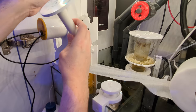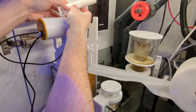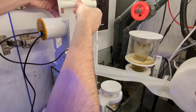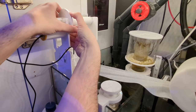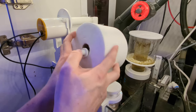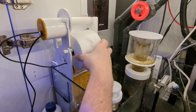Once the basket is down, attach the end of the new roll to the motor. There's no gripping mechanism on the motor spindle, so I just use a small piece of sellotape — a small piece does a perfectly good job. The spindle clicks into place; just turn it until it slots in. Make sure the central basket is pushed all the way down, then put the new roll in place on the spindle and you're done. The full unedited clip was just two minutes long, so the roll-change process looks pretty slick. I'll make a separate video showing the full changeover when I've used up the first roll.